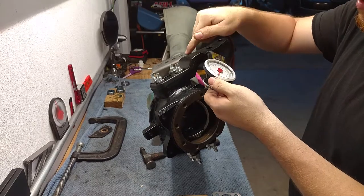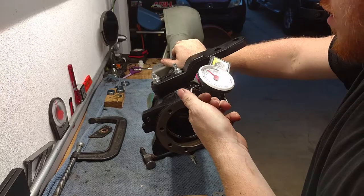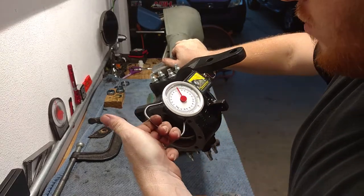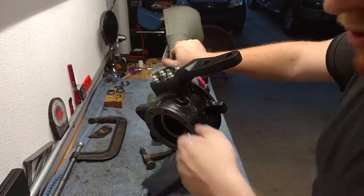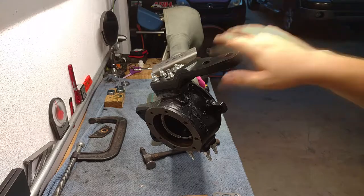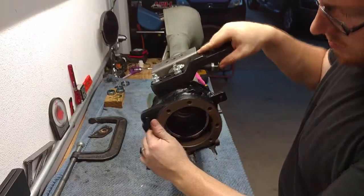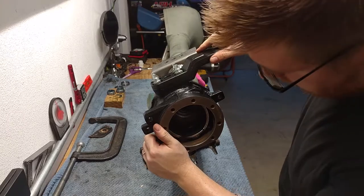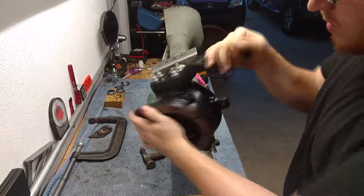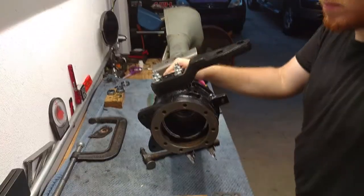Got 26-thousandths top and bottom and I'm pulling on it. It takes about 17 pounds of pressure to start moving, then runs about 16 pounds across the stroke. I think that's where I'm going to leave this one. So everything you just saw is how you assemble the knuckle on a Toyota pickup solid axle — really not difficult. It's just tops and bottoms, shims, bearings, until it's to the correct amount of pull force.